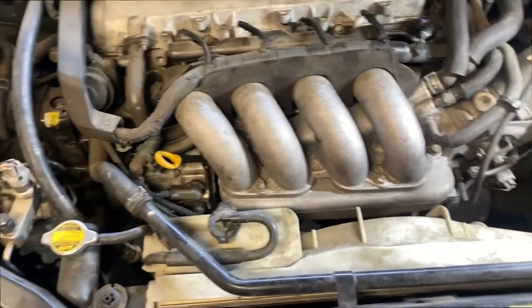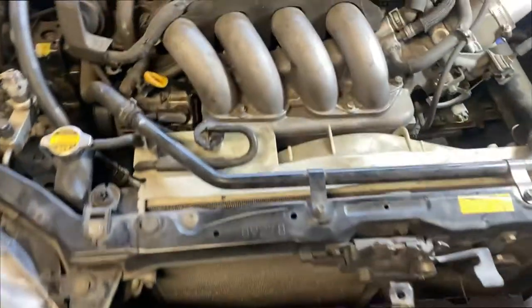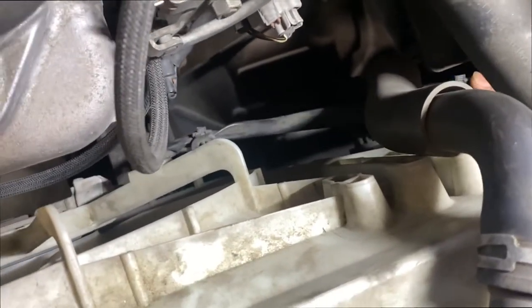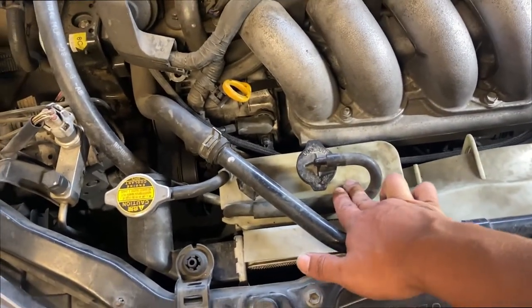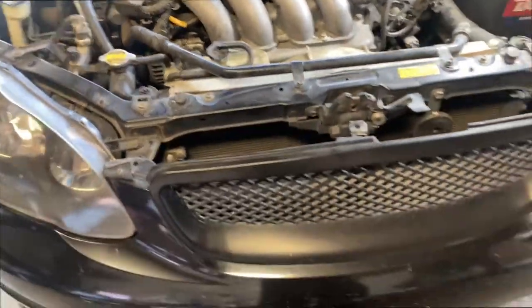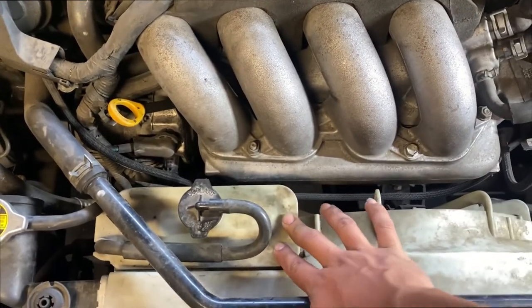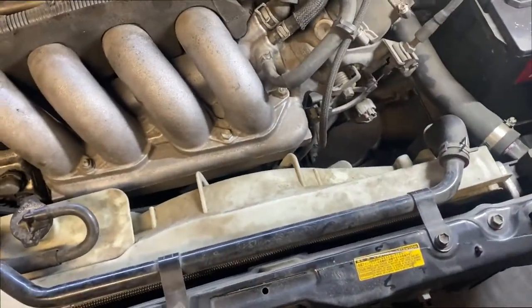So that's what I'm going to do. I'm going to see if I'm going to go OEM or if I'm going to upgrade to some better fans. Last thing I forgot is the plug for the fan right there, and it has like probably two clips. Get the wire harness out of the way. Just keep in mind that this reservoir does still have some coolant in there — you're going to drain it by hooking the hose from the bottom. I'm just going to be careful when I take out the fan shroud. That's probably going to be an issue if I do upgrade the fans, because I need to relocate this or make a new reservoir.